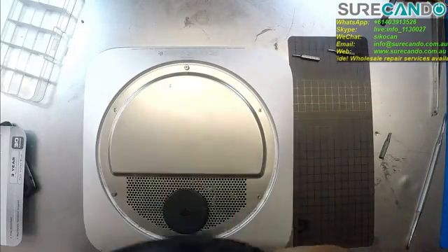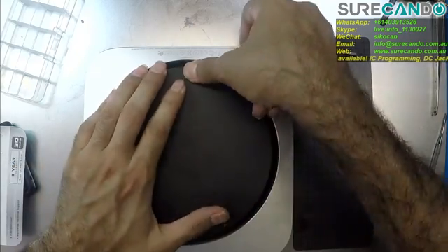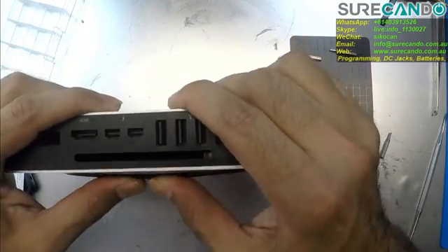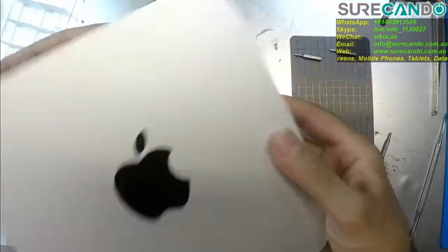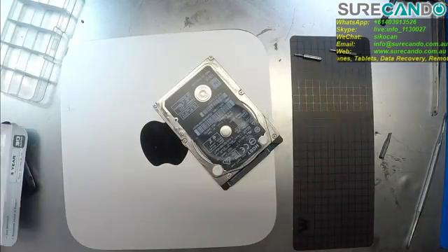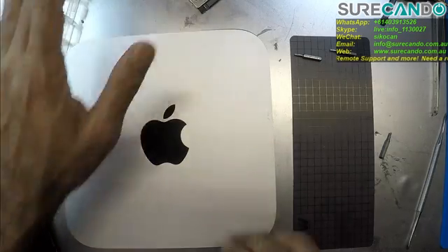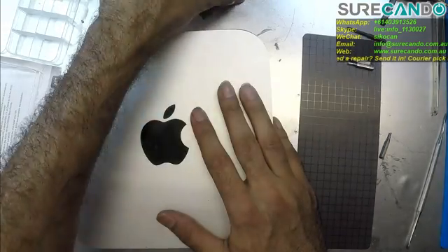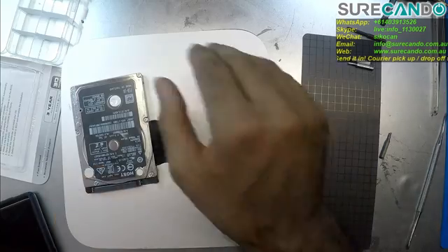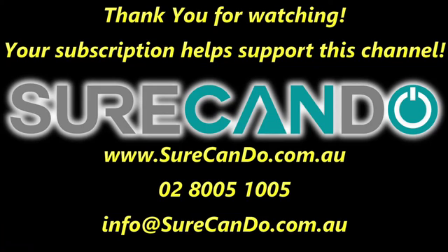Let's try that again. That's better. So that's the end of the video — that's how you replace a hard drive with an SSD. In the next part I'll be cloning it onto the SSD. The way I'll do that is I'll boot this off a USB which has a live operating system, and I'm going to use Clonezilla to clone it across. I'll show you that too in the next video. Thanks for watching. Please subscribe to support this channel.